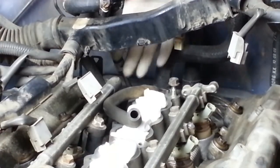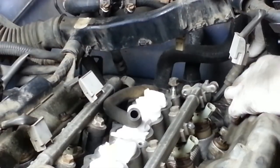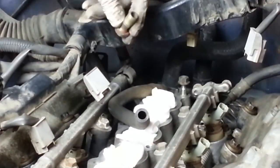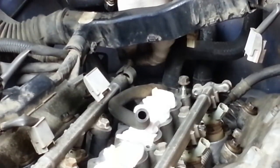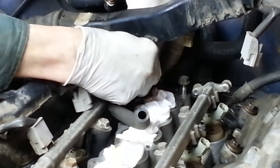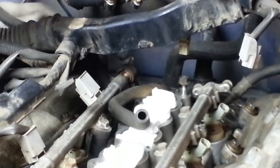And the fuel inlet hose attaches to the fuel rail right there, so we're going to run that back down and around. I'm going to hand tighten this fitting first before I attach the bracket in the back, and it gets a new copper washer on either side of the fitting here. One on the back behind the bolt head, and one between the fitting and the fuel rail. There's that washer. Now I want to make sure I get this started by hand so I don't cross the threads.